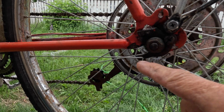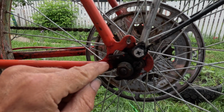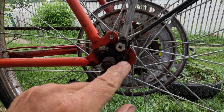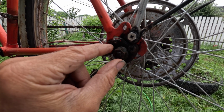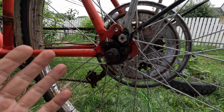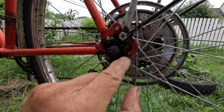But instead of just adding washers, what I did, and I have 100% confidence in that, is this. I found an old derailleur. This is upside down, guys, but see, this is where it's cut off. So I just simply used that piece that holds it in the dropout to make a thicker dropout. It works the exact same way as on the other side. It limits the travel. So ideally, you just pull it right back and it's aligned and everything. If not, this is a lot thicker and holds a lot better than the dropout by itself.